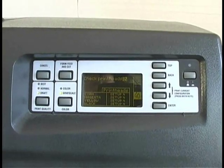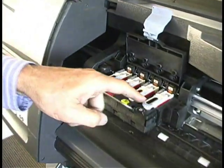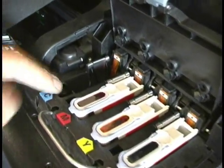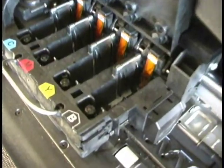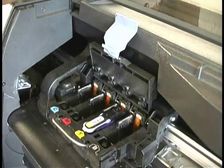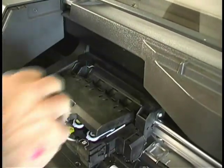We should have ink in here at this time. In just a minute or so, it's going to come back and say put the other print heads back in. There it is. Now if we look at these print heads, we'll see that they're all full of ink, meaning that the system is primed. And you notice, because of our check valve and that extra strength in that spring, there isn't any ink coming out at all when we pull these out - that check valve does the job, it keeps things nice and tidy. Now we put the original print heads back in. And we are finished.